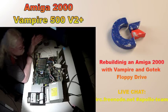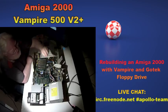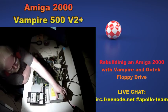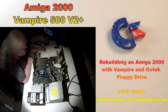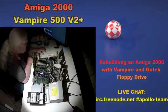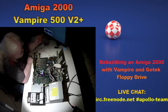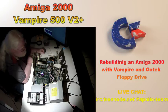So anyway, let's go ahead and boot this up, and hopefully we'll get past the corruption. Now, I am using a 128 gigabyte SD card, so it could be the adapter, it could be the SD card, it could be a combination of both, it could be the fact that I had it on a cable or whatever. We'll see what happens. I did see a little red blinky light there. Oh, by the way, the power LED is not on. Okay, so it did not boot.